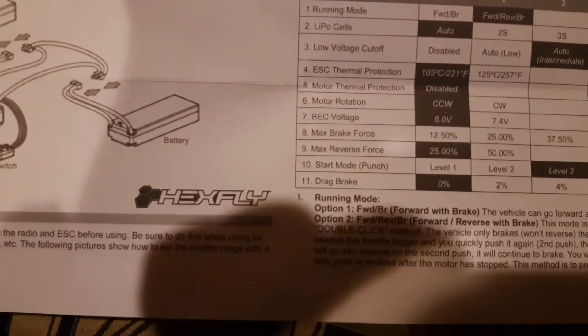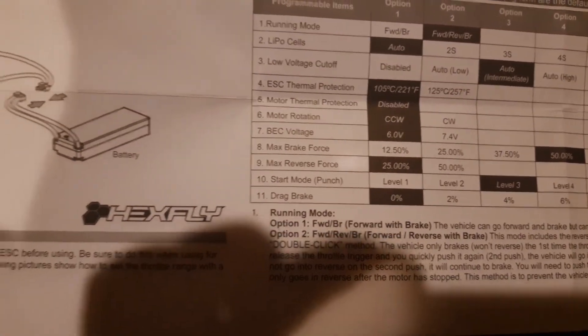So what we're going to do is press the set button until we get to option 3. We're going to have to go through all the options, then go back to 1, 2, and 3 and set it at 37.5%. Now at this point our brakes are set at only 12.5%, but I want it at 37%. So I'm going to go to option 3 - I'm going to hit it 2 more times. And then when you're happy with your setting, you're going to want to turn your car off. Now when I turn this back on, my brakes are going to be set at 37.5%, which is option number 3. That's just an example of how you would do it - you hold your set button until you get to the right item, which is that 1 through 11, and then you keep pressing until you get to the right option.